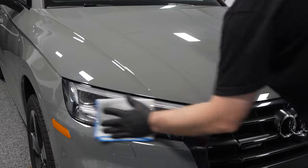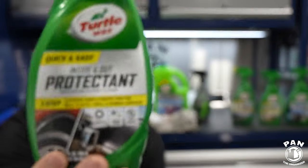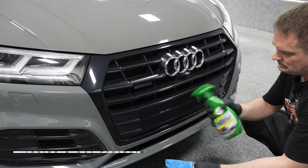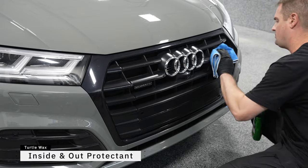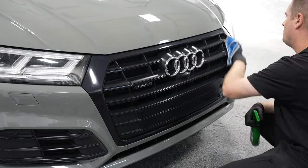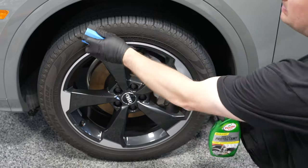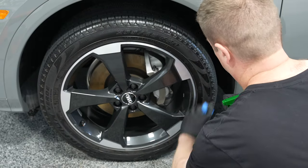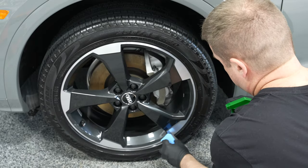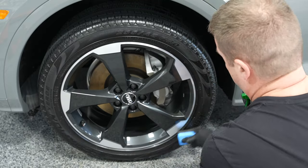No detail job is complete for the exterior without adding a bit of pop, gloss, and protection to your tires and plastic trim. For that, we're going to use the Inside and Out Protectant. On exterior plastics, spray on a microfiber towel, rub it in, and if you want, take a second clean dry towel and buff to a streak-free shine. For the tires, we use a tire dressing applicator — I always love these because you don't mess up your hands — apply it to the tire sidewall, and that's it. It gives UVA and UVB protection, helps against fading and cracking, and gives you that nice finished detailed touch that separates your car from all the others.